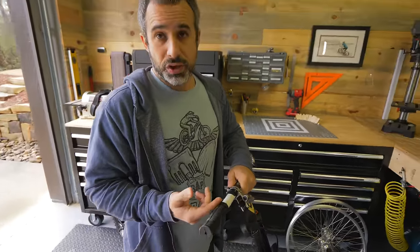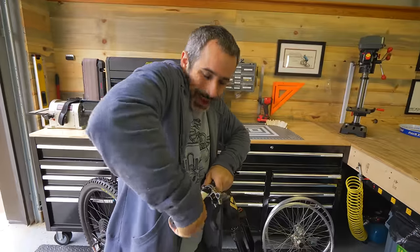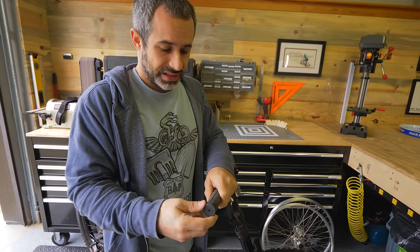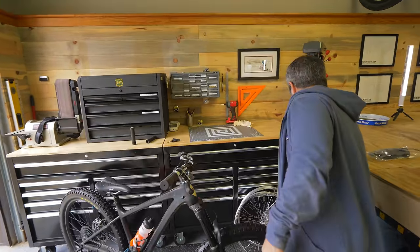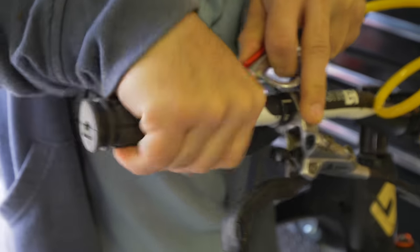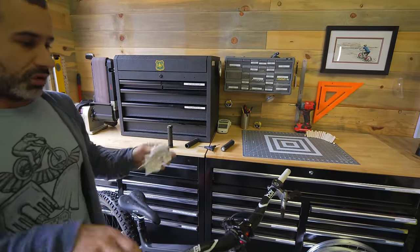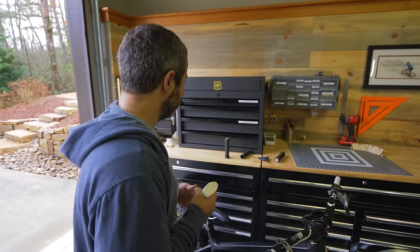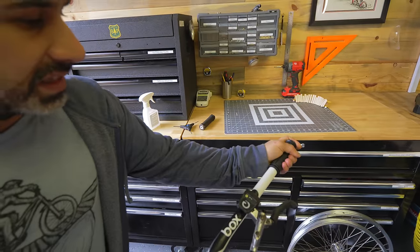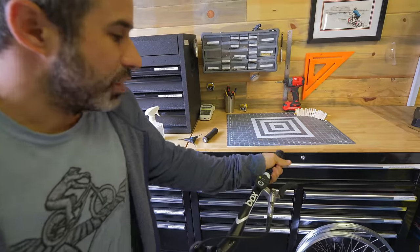Normally you get to a certain point and it won't push on anymore — it's just too gripped on the handlebar. These ones you can twist and force on, but that's not good. You don't want a grip that moves. I'm going to show you two ways to install them properly. The first is with an air compressor — shoot some air in and easily push the grip to the end. The second way: put a little rubbing alcohol inside the grip, not too much, and the grip simply slides on. You can twist and mess with it, and the rubbing alcohol evaporates so the grip is good to go.